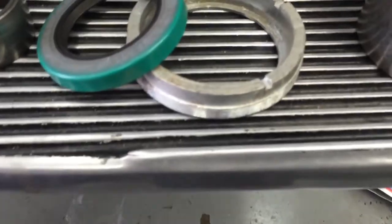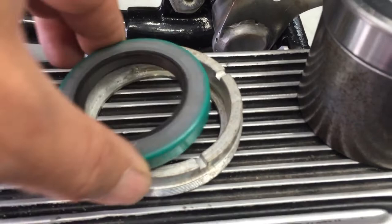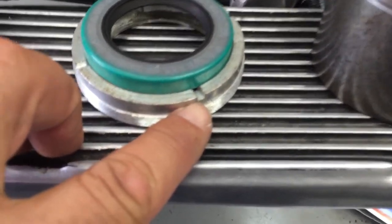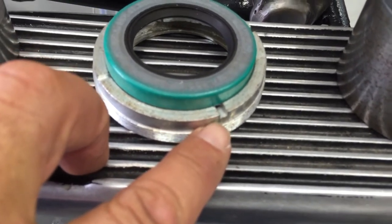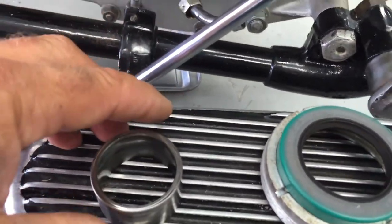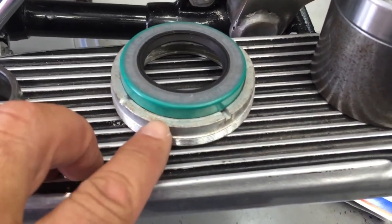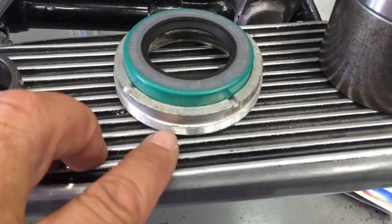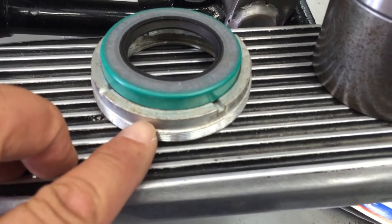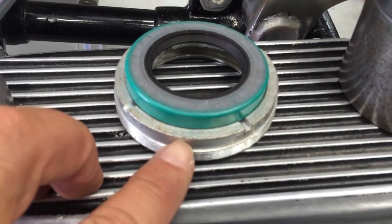So this is the upgrade — the bearing retaining nut. This seal presses into there and we've got another spud that presses it in. This is the output collar. I always advise upgrading to the bearing and seal. It gets a little close on 1939 and earlier models where the output is narrower. Sometimes before you even start, just do a dry installation of this without the seal — and sometimes you've got to go to the lathe and trim this back a little bit.